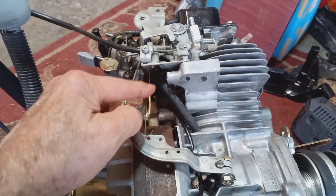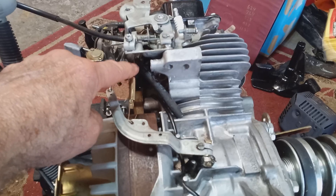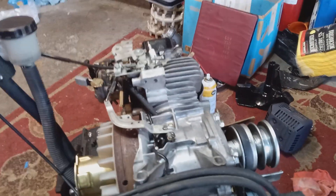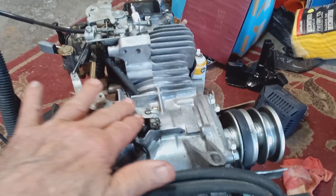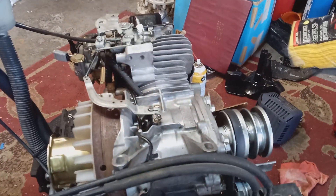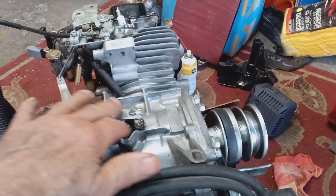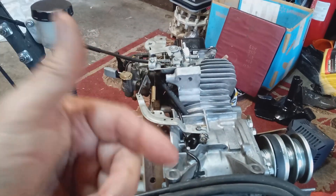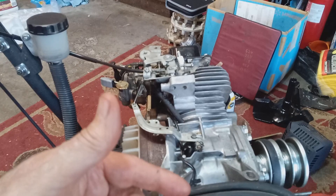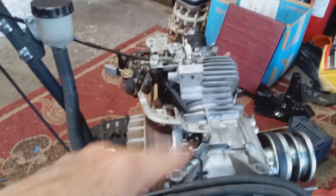With the gas tank on, I really couldn't see this spring very well. The spring was snagged on my coil cover. If I had posted this on a Facebook small engine group, everybody would come back and say you need to adjust your governor. Now that could be true if you rebuilt the engine and the governor was out of adjustment, or if the governor broke. I don't have a governor wheel to show you with the flywheel weights, but if the governor breaks inside, it's going to race on you — shut it down as fast as you can before you blow up the engine.